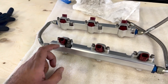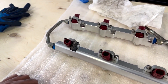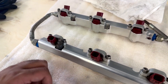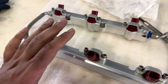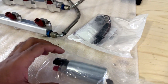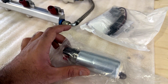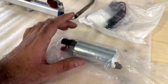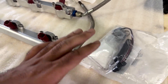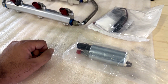With the new injectors I also need new plugs and new wiring. If you've watched my other videos you know I have a new wiring harness for my car, and that harness has the new style plugs, so that's going to be a plug-and-play situation. I'm also upgrading my fuel pump because the NA fuel pump is not sufficient. I have the Walbro 255 fuel pump with the install kit — it's supposed to be good for about 550 to 600 horsepower.